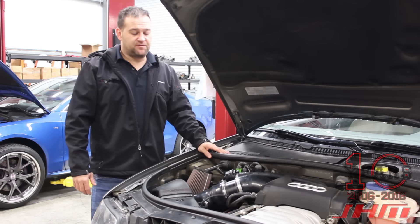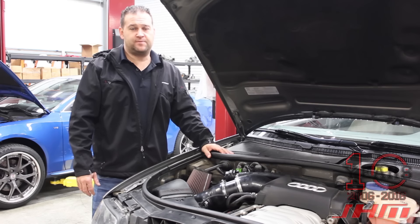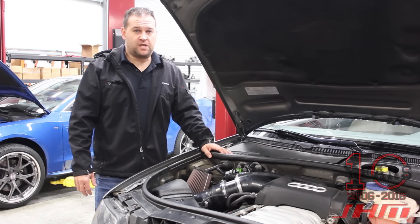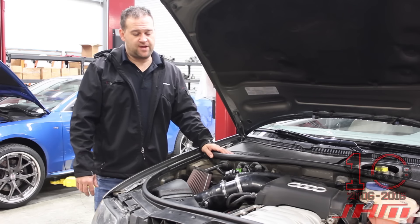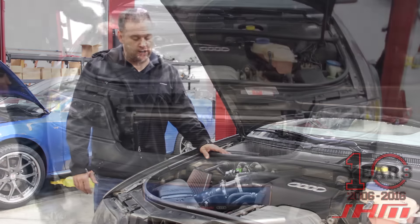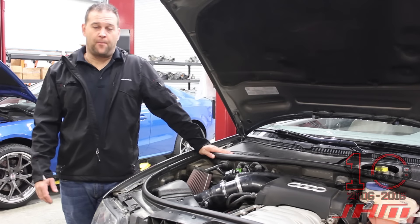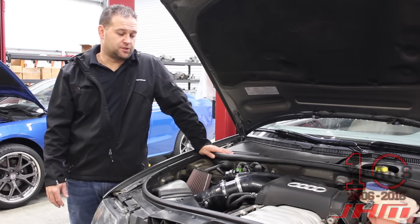Now I want to go into the specifics of this car. This car has our supercharger kit — our Stage 1 six-and-a-half PSI kit that we sell for the B6/B7 S4, which has been on the market for about five years. We also have on this car the first-of-its-kind zero-A3 manual transmission conversion from a B6/B7 S4, which was quite difficult to make work due to some electronic features missing from that transmission. We knew the supercharger kit would fit — it just took getting a car here. You can see the intake filter and boost hose, supercharger down there — same kit with only minor installation differences and fewer AC system modifications. This supercharger kit is now available for this car.